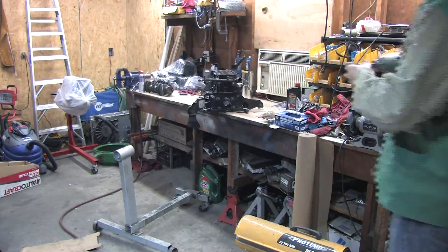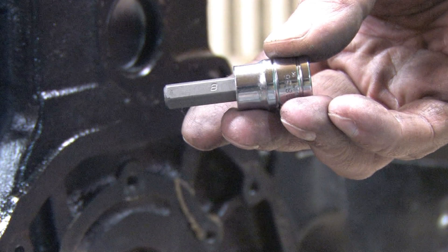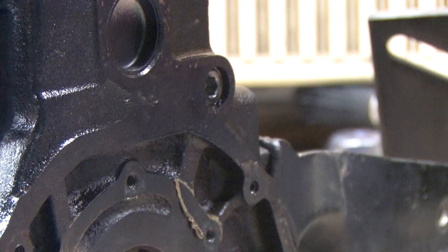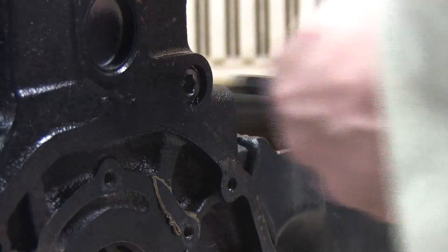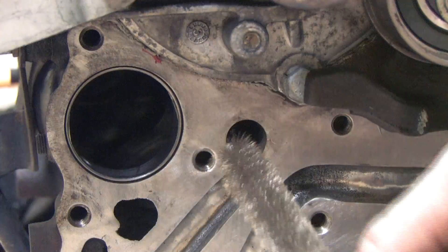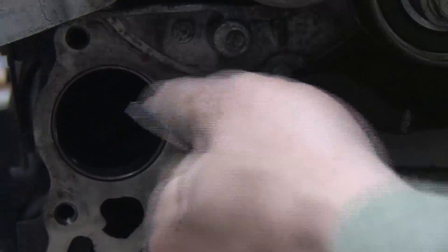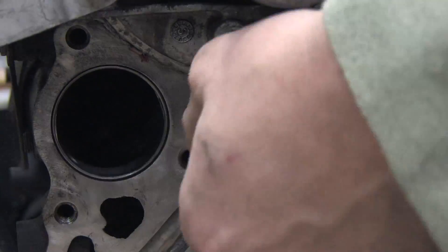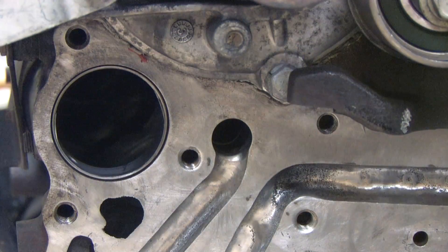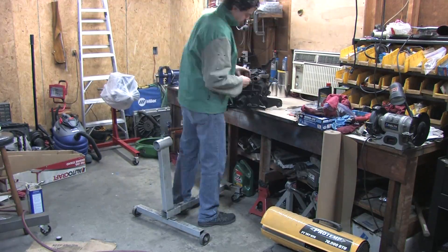In order to get into the main oil gallery, the engine stand is in the way of the main oil gallery plug. To get it out takes an 8mm Allen head socket — you're not going to get it to budge with an L-shaped Allen wrench or a T-bar. That's not coming out. I probably should have heated the block up first with a torch and used penetrating oil. Call that a rookie mistake — learn from my mistakes. So now I can only clean three quarters of the way into that oil gallery, but any way you slice it, this is still an improvement over what I had.